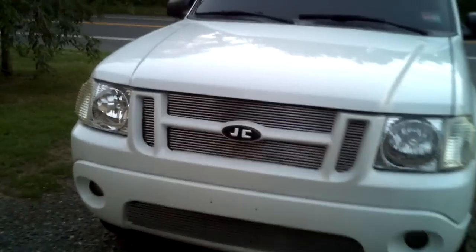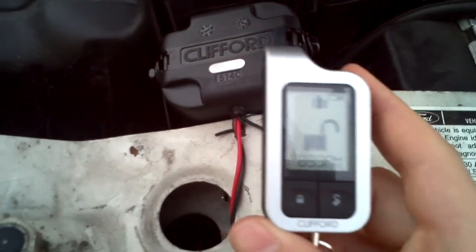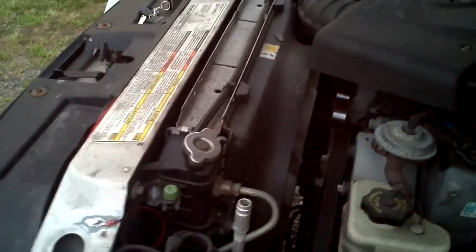So now I'm going to show you where I mounted my speakers. The cool thing about the 516U is that it will mimic what your remote start car alarm stock siren does, so it kind of doubles the loudness that you already had. This is the one that came from Clifford, mounted down so that all the water falls out. And then the other one I mounted — the one that comes with the 516U — is right behind my radiator all the way at the bottom, close to the ground, facing down so that it will bounce off the ground and everybody in the proximity where my truck is can hear it.